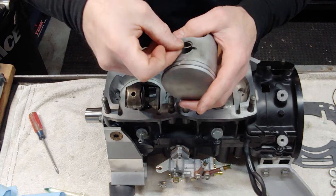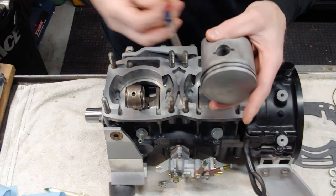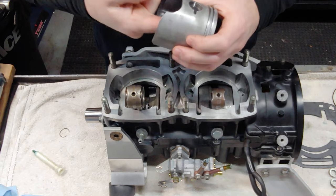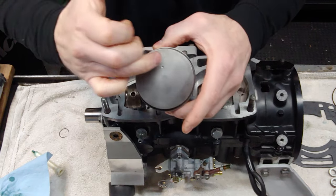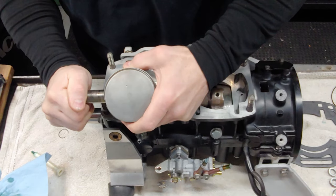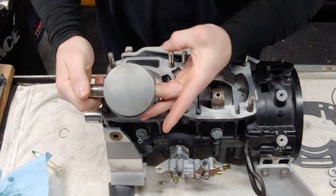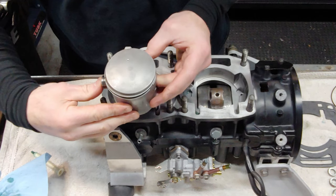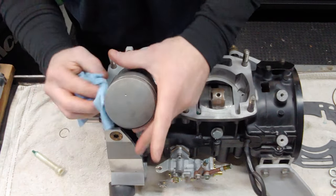It is okay if you put them in on some sort of an angle — just make sure you've got something to switch them with or move them over. You want to make sure that every contact surface has a little bit of oil on it. Punch mark towards the exhaust side, or front of the engine. I like to stick my finger into the piston and then through the bearing — that helps guide the pin all the way through easier, and then you should just be able to push that sucker right in.